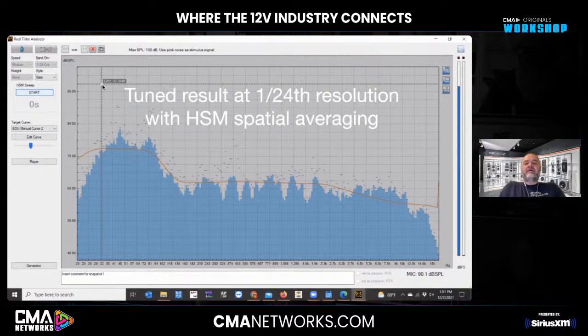So the reasons that we've added these features: number one, test the signal before you connect it to your DSP. That will tell you how many signals you need and what's being done to those signals. If you need to correct phase processing, you may need to change the equipment you're using to do it. If you have a car with advanced phase processing and the speaker system needs everything to be in phase, then you may need to change the DSP that you sold the customer.